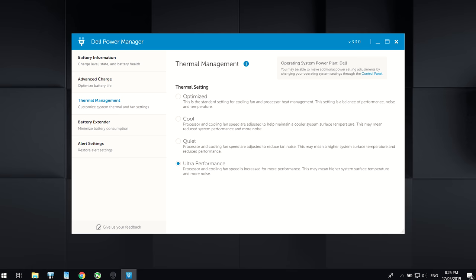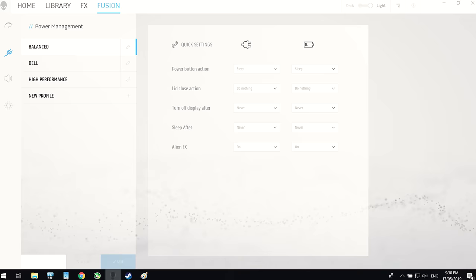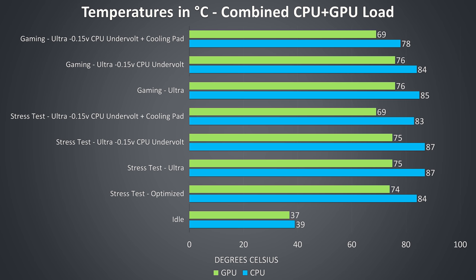While you can install the Alienware Control Center software, this did not give me any fan control — the best you can get is changing between the Power Manager profiles. Thermal testing was completed in an ambient room temperature of 21 degrees Celsius, so expect different results in different environments. I've tested idle with the quiet profile, and temperatures seemed about average while also being quiet. The rest of the results are from combined CPU and GPU workloads and are meant to represent worst case scenarios.